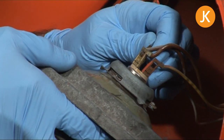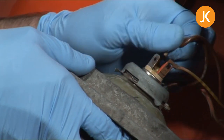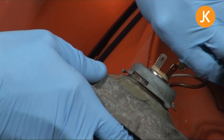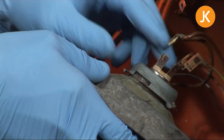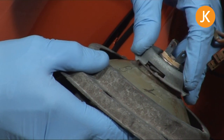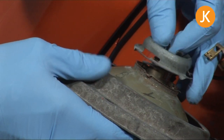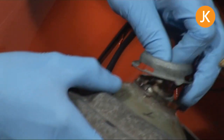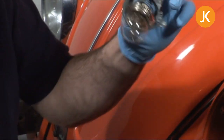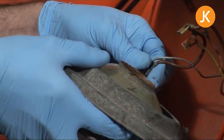Making sure you're not going to get any sparks, we can gently prise these off — they're slightly rusted into position. Now to remove the bulb retaining system: it's a gentle push down and then a swivel and it will just literally lift out. You can then usually just pull the bulb out. And now we can see a bog standard bulb in there — which is actually broken, as you can probably hear it tinkling.